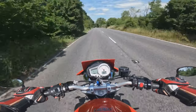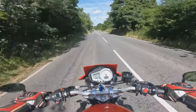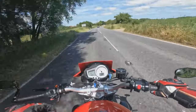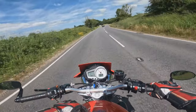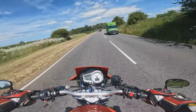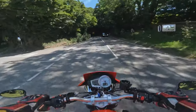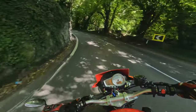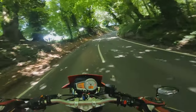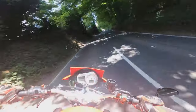A few basic specs to start off with: 190 kilos out of the factory — I believe that'll be a dry weight — 130 horsepower and 78 foot-pounds of torque. We've got an inline three-cylinder triple engine, 1050cc, hence the 1050 Speed Triple name. Obviously this was also available as the Street Triple with the 675 engine, but this is the big daddy 1050. These bikes were produced by Triumph in an era where the streetfighter generation was out and about — quite a custom theme to them, cutting the back end of the bike off so they're quite short. Quite a steep rake angle on the head, 24 degrees on this I believe. It's all about customisation — that's the kind of pattern that these Speed Triples follow.